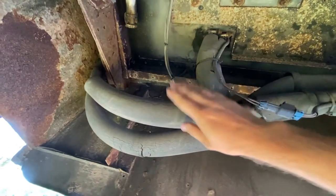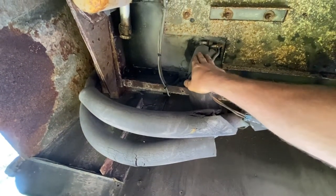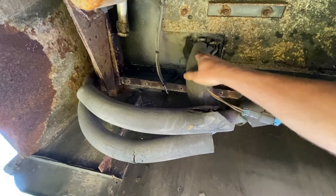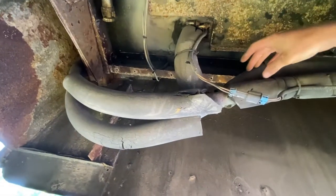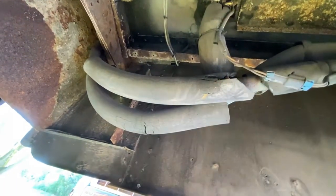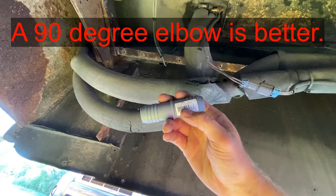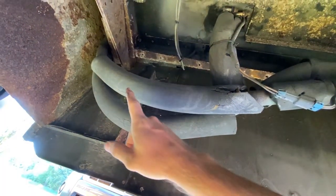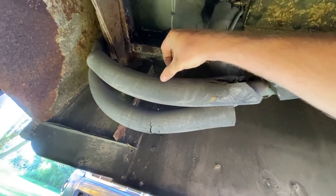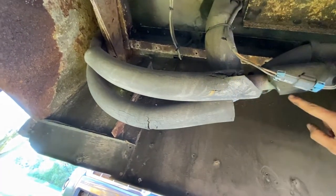The first thing I'm going to do is just take the insulation off from the rear loop here. I'm going to leave the driver's side heater attached — you can bypass that if you want to, and if you do, then take these off. Essentially what we're going to do is get a coupler like this that you can get at Home Depot or Menards. I've got a one-inch coupler, and you're going to basically cut these two lines right here, then attach this hose to this hose back here, so the coolant runs here and just loops right back around.